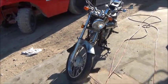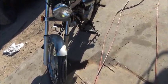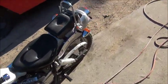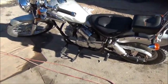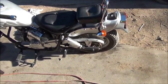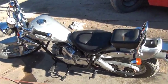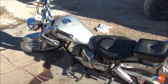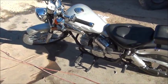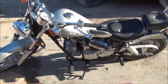It probably uses a bit more fuel but who cares, it's fun — you only need a car license to ride it. It had been sitting around for about a year, so the tires went flat. They are tubed, so I'm not too worried about that. We left the fuel on and as it all evaporated over the year it deposited a hell of a lot of crap inside the carburetor, as you can imagine. So I cleaned all that out the other day.